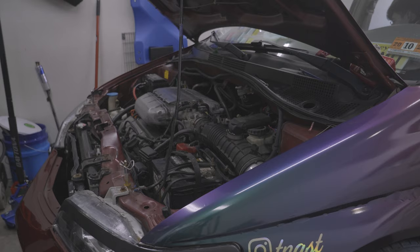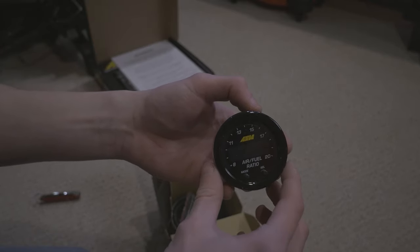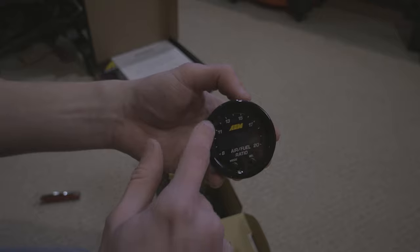Even though the ECU is good to go, I still can't drive the van quite yet. I need to finish the transmission controller before I can get it moving under its own power — though I found out it will move without the controller, it's really not a drivable scenario. I also need to rework the J-pipe to eliminate some leaks, and I'll be installing a wideband sensor, which is basically an O2 sensor that connects to the ECU and gauge to tell me my air fuel ratio — that's going to help immensely when it comes time to actually start tuning. As I rework the J-pipe, it's going to go from an equal length setup to an unequal length setup, so it'll either sound really good or really bad. If you're not subscribed, make sure you are so you don't miss a single bit of progress on this build. As always, let me know what you think down in the comments, and until next time, stay classy.